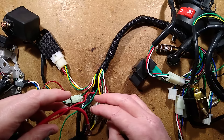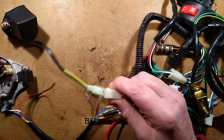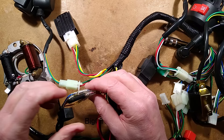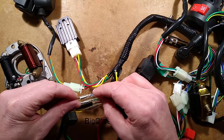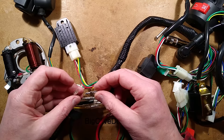I've already mentioned this to the patrons, and one of them asked: what are the connectors like? And the connectors are, quite frankly, a bit rubbish. Nothing is waterproof. The push-together bullet connectors for the stator on the magneto were super loose — I had to widen them before they'd actually make a decent fit. That's pretty much the sort of fit when they arrived, so the plastic housing is doing more of the job of keeping that in. If you get one of these, it's worth flaring these connectors out a bit before you put them in, or replace them with better connectors.